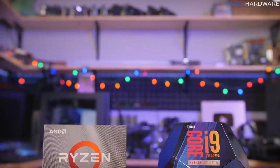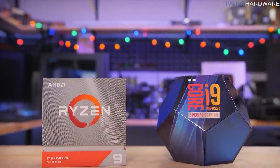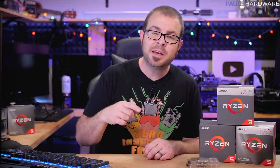Because of those extra cores and threads, performance is usually better with AMD CPUs at the same price point. Gaming performance is the area where Intel still held the lead up until the launch of third-gen Ryzen processors last year, when AMD closed the gap with their 7nm CPUs. To be fair, Intel has an upcoming launch of LGA 1200 motherboards and CPUs known as Comet Lake S, based on a 14nm manufacturing process, launching within a month or two, so that might slightly change the scenario.